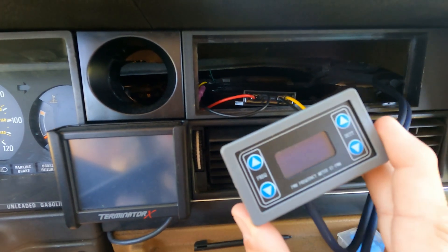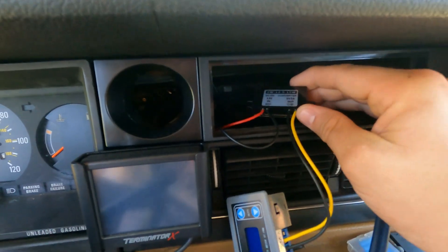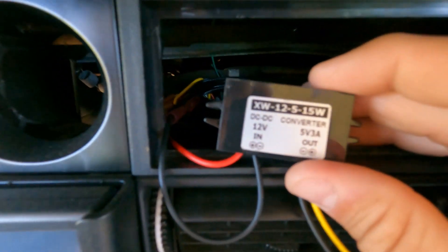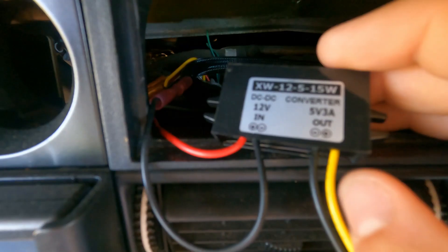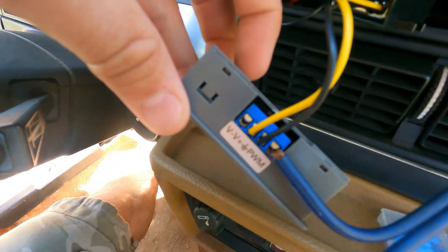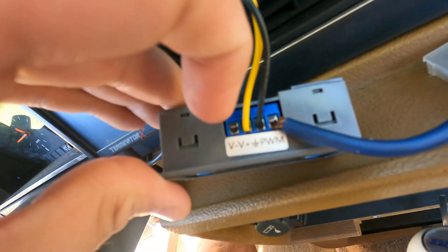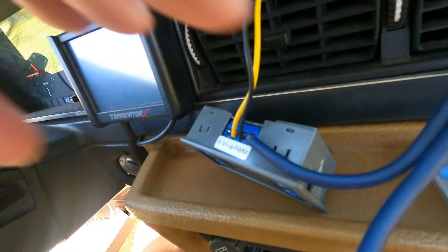All this is doing is chopping up the signal — chopping up five volts — and we're going to control it. This simple device is a DC-to-DC converter; it steps down 12 volts to 5 volts. Red is 12-volt positive, black is ground on both sides, yellow is 5-volt out. So we have 5 volts coming out here. On this unit there's an instruction sheet that comes with it but it's not necessarily accurate. The voltage negative — don't hook up anything there. The voltage positive — that's your 5-volt positive. The ground symbol is where your ground wire goes. And this wire right here — I'm actually using speaker wire — this goes to the red wire on the alternator. Simple as that.